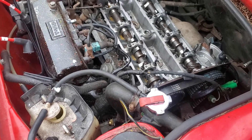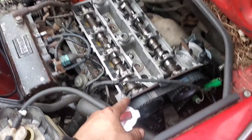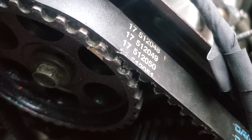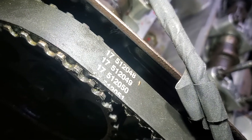Here's how I set the timing on this. You would set the intake cam to the line. I put a mark on the dot and then set it up to that line right there, which is really hard to see. It's a line on the backing plate — you can kind of see it. Set the dot on the cam to that.